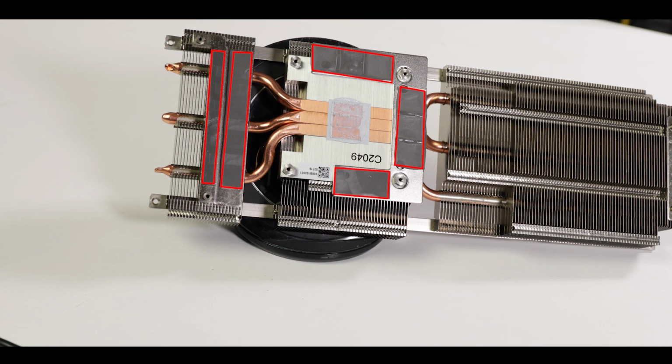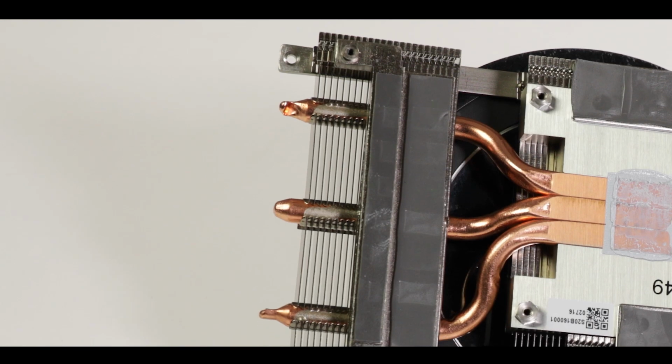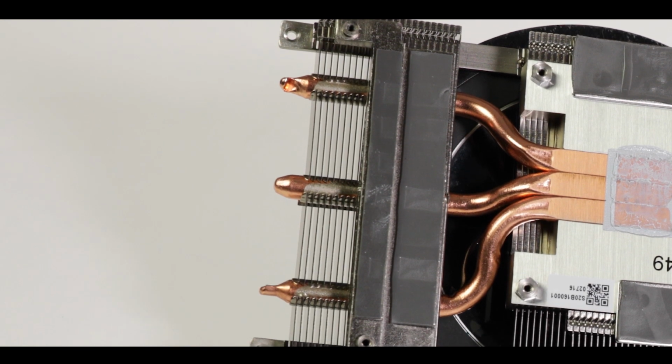Thermothrottling is probably what your card is doing. In short, it means that your video card is slowing down its most heat-producing components to save itself from a burning scene of hell and fire. It happens as the pads and paste, which transfer your components' heat to the heat sink, start to age and lose their ability to do so.